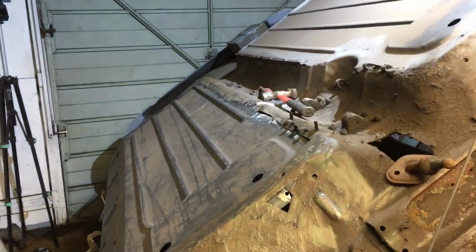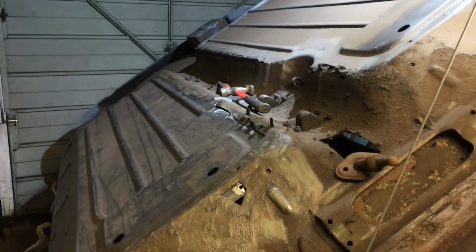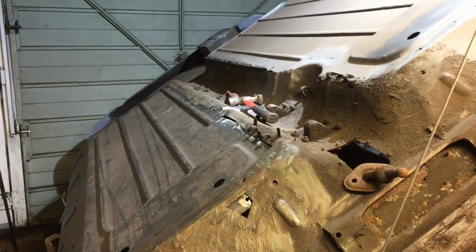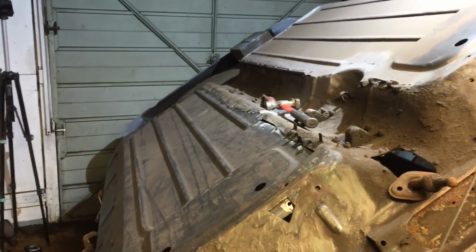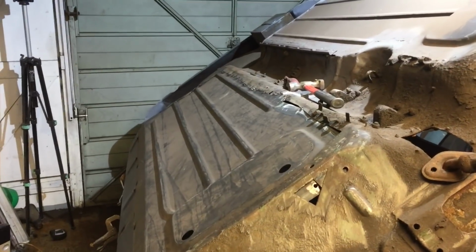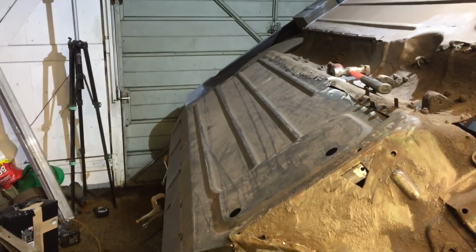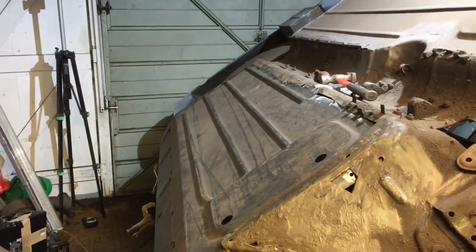Again, do it in lots of little stages and let it cool down. I did that, you got to be careful. Welded too much on the other side, and big sheets like this distort quite easily if you're just doing lots of long welds or just lots of short welds but over a long area, because the heat builds up and it just distorts, like you get in the old oven tray. You know, some of your oven trays go ping pong when they get too hot inside the oven. That's because they're all under tension, but the heat makes it expand and poof.